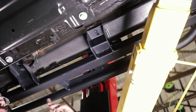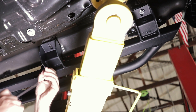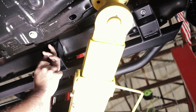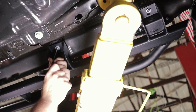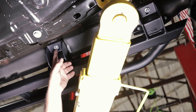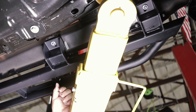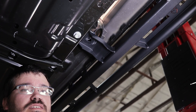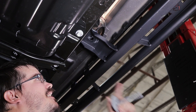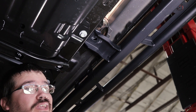Once you've got it hanging from the front and rear, it's time to go ahead and start the vertical bolts. Use the M8 button head, which is a 5 millimeter Allen, or if you have the Rubicon, you can go ahead and reuse the stock hardware if you wish. Next is installing the body bolt — now this middle one can be a little bit tricky; it's easiest if you put it in with an impact.